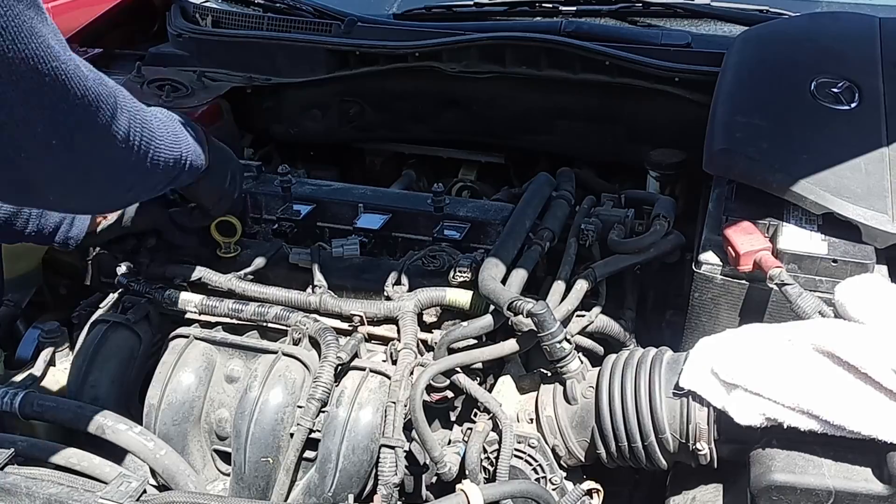I don't see any leak, so I'm gonna check if anything is reading differently. I have a multimeter here — just gonna set it to 200, black to black, red to red. I got two alligator clips and connected them to the fuel injector. I use alligator clips because I want to make sure everything is clamping properly so it doesn't mess up the reading.